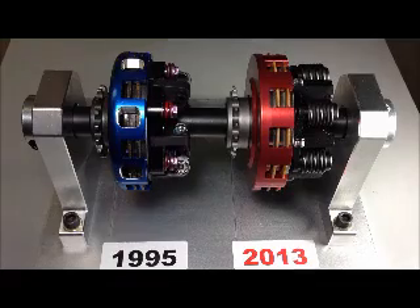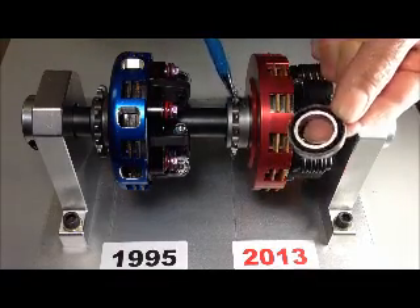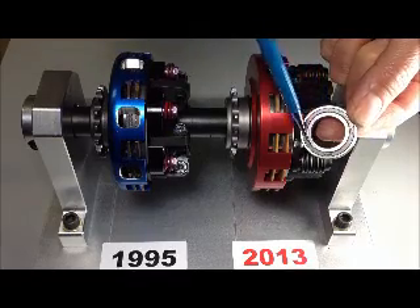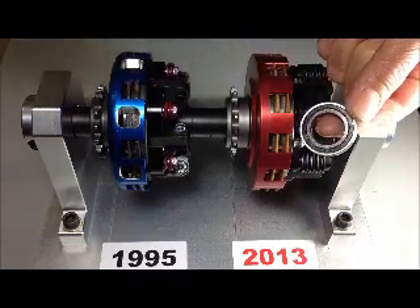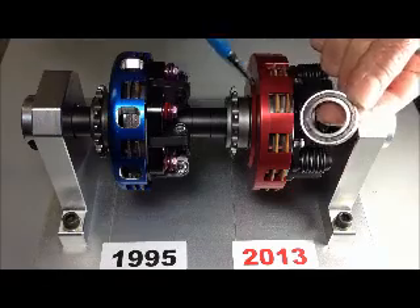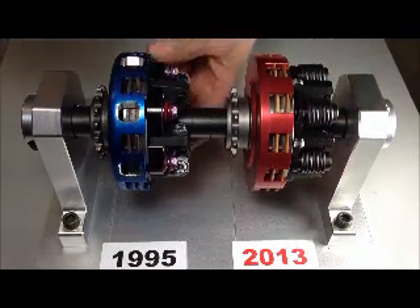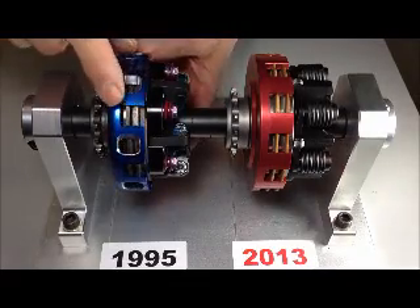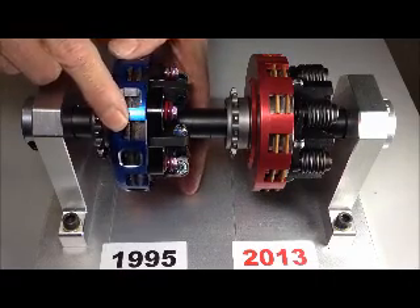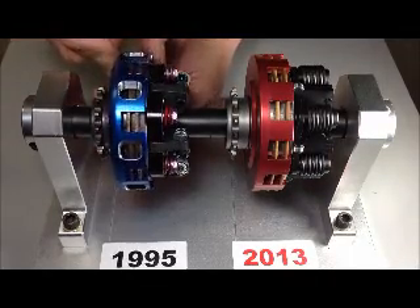What really is different in 2013 is that the sprocket is not connected with a needle bearing, but instead a ball bearing. The ball bearing is a deep groove type, which gives us a thrust load capacity. It's got a seal to exclude dirt and retain grease. The ball bearing is important because when the clutch employs a needle bearing, it is free to translate because it has very little thrust capacity, and it will rock.